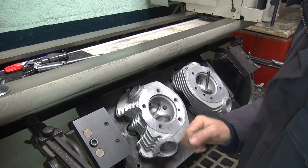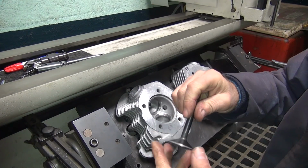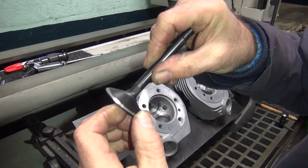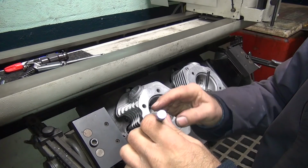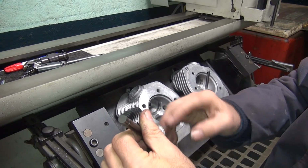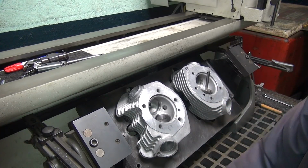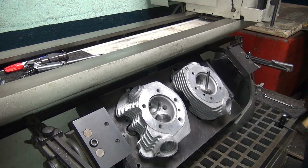Alright, that was the rear valve, that's this one. So you can see what the lap mark was. See how it's got a pretty good area on the top here where it's not all the way up the top of the valve. After I lap this again, it'll be right up to the edge there, close to it. Right now you're not using the full valve diameter, pretty much giving away your excess valve size. If you're not out there to the outside edge, you're not taking full advantage of your valve.